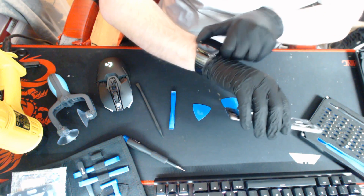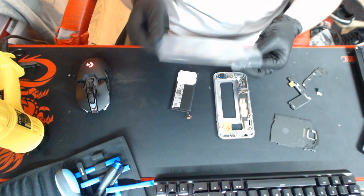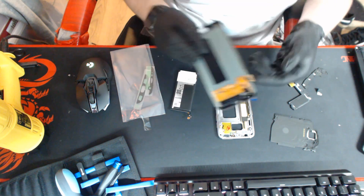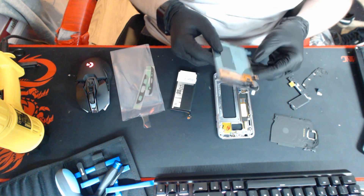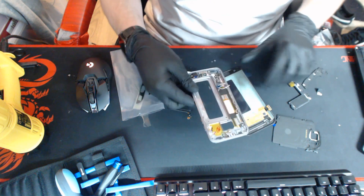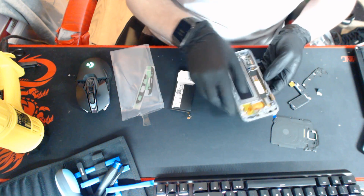So I'll hoover all this up because I don't want glass everywhere. I'll see if the new screen works first, because it would be a royal pain if I got the back button and charging assembly, put it all together, and then the screen didn't work. I think it just needs that one connector — so it goes on here, that goes in there. I'll just test it temporarily. Moment of truth.